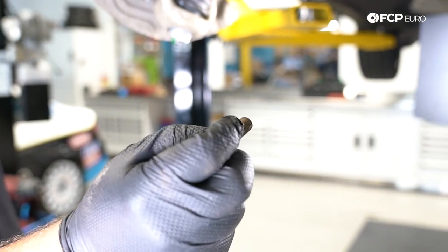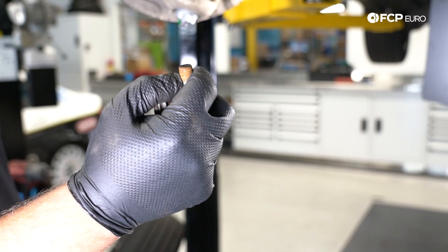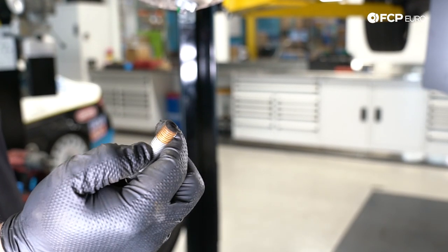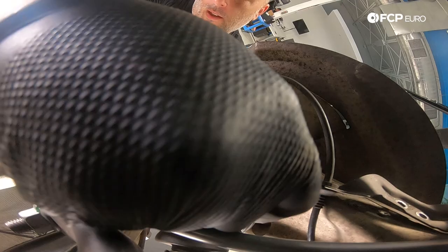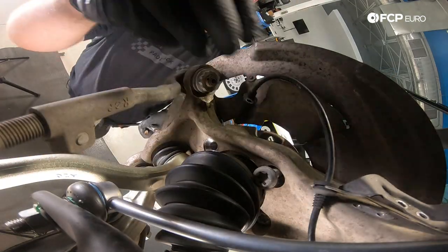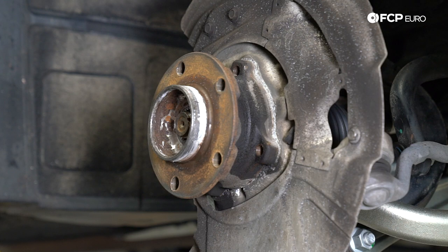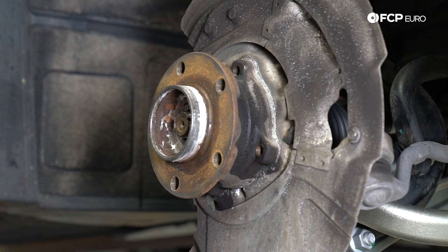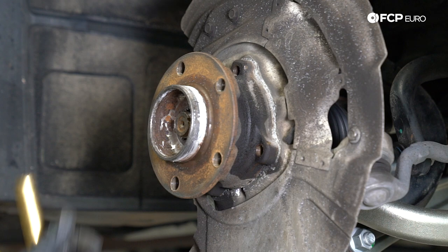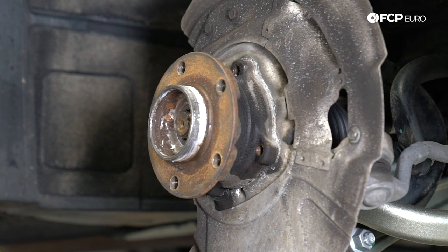The corrosion I was talking about is right on the end of the bolt where it sticks through — I put some penetrant on there, and in all honesty it seems pretty clean. I've had a couple of these wheel hub bolts be really tight coming through once you hit the corrosion. Same thing on the back two bolts with the T60. Now we're at the point where we can pull the wheel hub assembly off. However, to be completely honest, it's an aluminum knuckle with a steel hub — there's going to be corrosion and it's going to be pretty tight.